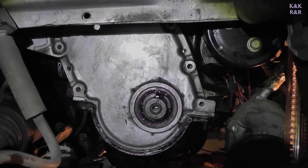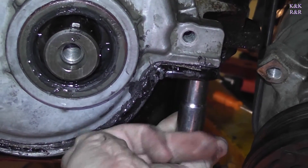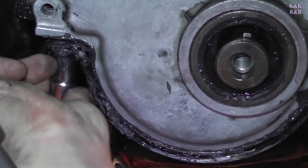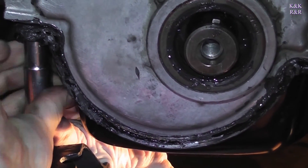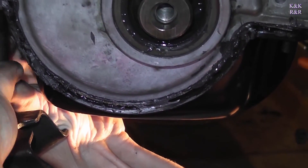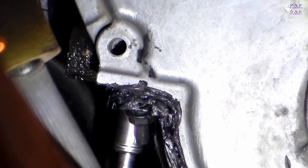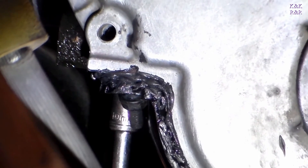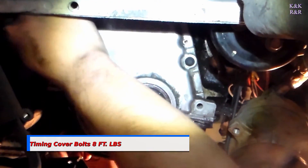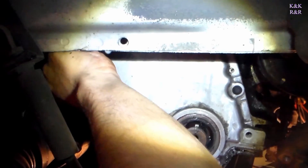The 2.2 is an interesting beast. Just want to run the bolts down lightly — you don't want to squeeze the gasket yet; you want to give it time to vulcanize. Vulcanize time will depend on temperature — the warmer it is, the quicker. Today we're at about 80 degrees, so we've got about 10 minutes of flash. Ridiculous amount of RTV you've got to use on this. You might want to put a bolt in to hold the cover on while you're trying to sandwich these two together, or it'll get whompy and the bolt will pinch — bad things will happen if you don't do this step.